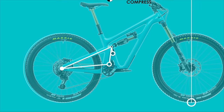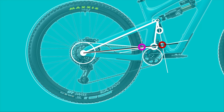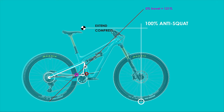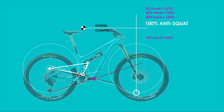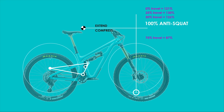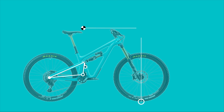When one starts looking at anti-squat, one will notice that for most of the travel the values for the SB150 and a similar single pivot design aren't too dissimilar, however they do diverge drastically during a key portion of the travel — the last 30%. During the first 50% of the travel the anti-squat values are between 120 and 130%, meaning that this thing is going to pedal like a mountain goat. Some will note that with high anti-squat numbers climbing technical uphills can be a little bit more difficult, as the suspension wants to extend rather than compress when you pedal up square edges. But I would far rather have an efficient pedaller than pedal bob, especially when one considers that a lot of climbing takes place on smooth forest roads. During the last 30% of travel the anti-squat of the SB150 starts dropping quickly, unlike a single pivot design, such that as you get to 100% travel the anti-squat values are well into the negatives. Why is this a good thing? Pedal kickback. With low anti-squat values deep in the travel you're going to get less pedal kickback, or another way to look at it is that the pedals won't hinder suspension movement, and the rear wheel will hold traction better.